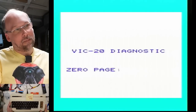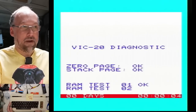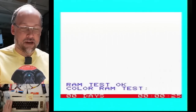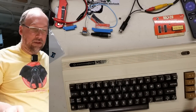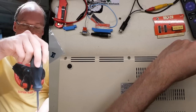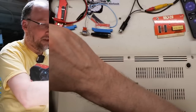So let's plug in the diagnostic cartridge. I'm going to take this jumper off because this is an NTSC machine. Let's plug this in. First we'll try it without any of those loopback adapters. I think I've seen this simple diagnostic before and I didn't realize it could use a test harness. It does some RAM tests on the static RAM inside. The fact that it says 00 days implies this diagnostic ROM is used as a burn-in test — you could just leave it running indefinitely. Serial bus bad — okay. Well let's take the screws out and plug in the keyboard loopback.